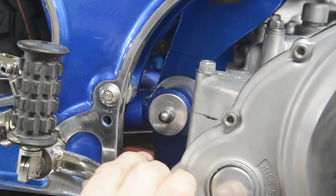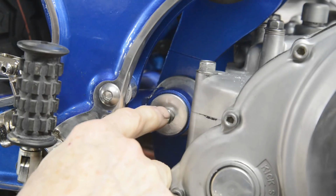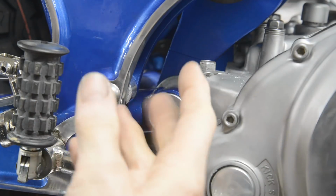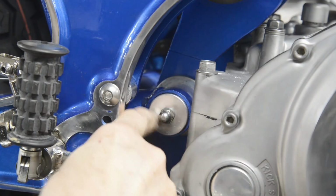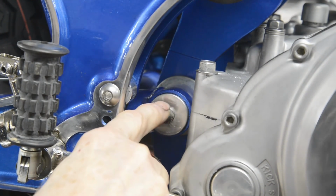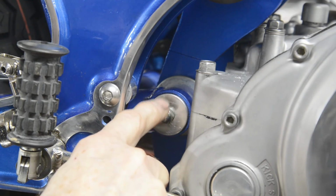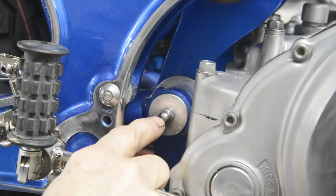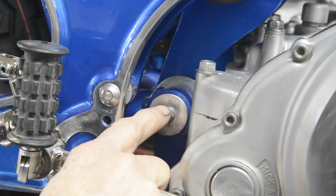And then on the forums I found out that most Commando owners, or a lot of them anyway, seem to dispense with the nipple and just put a plug in, and then use something like one of those plastic syringes or an oil can or whatever to fill it up and keep it topped up. So what I'm going to do is drill both discs, tap them, and put, I think, a 5mm Allen bolt in, and then we'll put a fibre washer under each of these domed nuts and a little fibre washer under the Allen bolts.